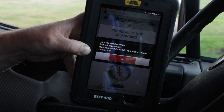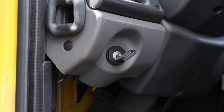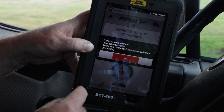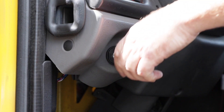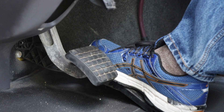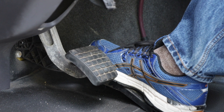I'm going to press start, and then I'm going to turn the ignition key to the run position. This allows the truck to boot up, and if the truck has a grid heater or glow plugs, this allows time for those to cycle on and then off. Start the engine. Then we're going to rev the engine to governor speed to get the alternator in its efficient range for the test.